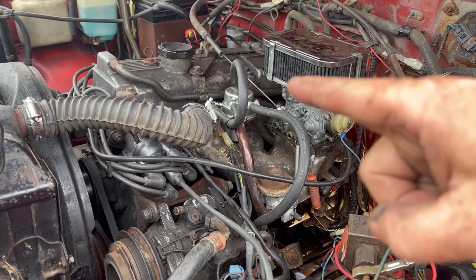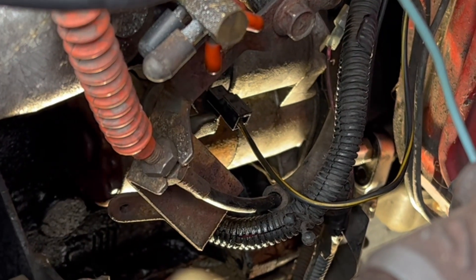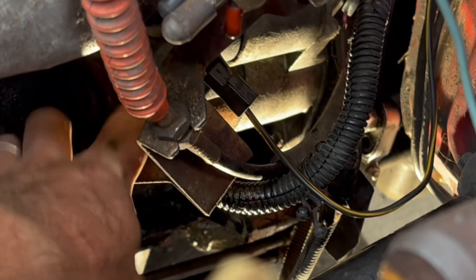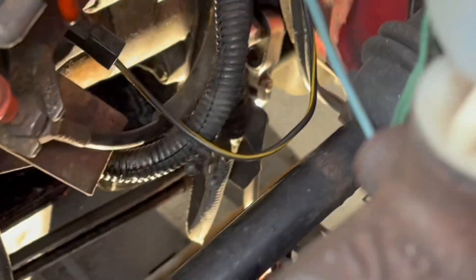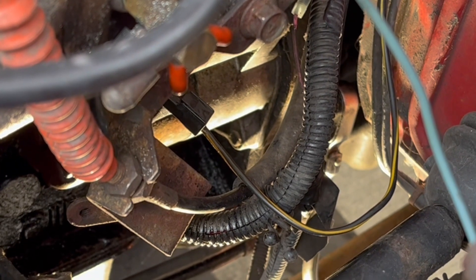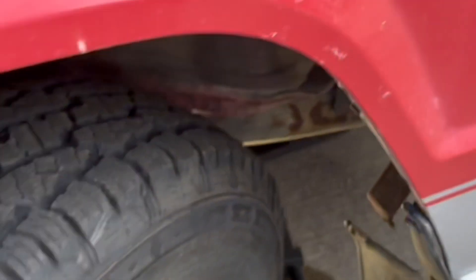On the 1987 Dodge Raider with the 2.6 engine, the starter is down there. Now, the electricals you get from the top — it is this black and yellow plug that I already pulled off. Then you've got your big wire going to the battery, your heavy gauge that goes over to positive. What holds this thing on is two bolts: one is right up against the firewall and comes in from the bell housing side, and the other is on the bottom. Both come from the transmission side, which means to do this job, you either need four elbows or you've got to take the skid plate off.